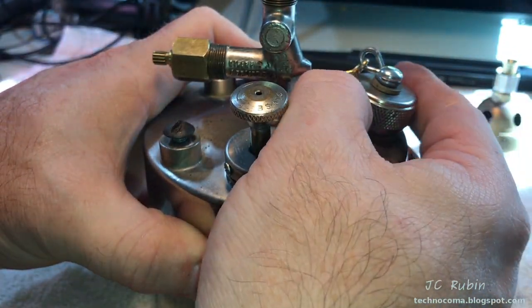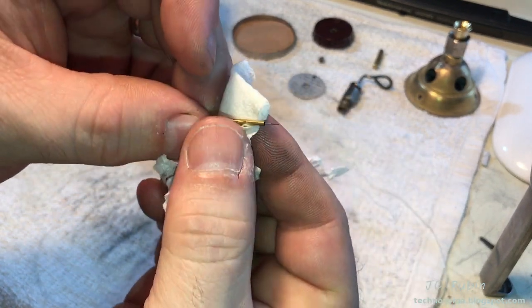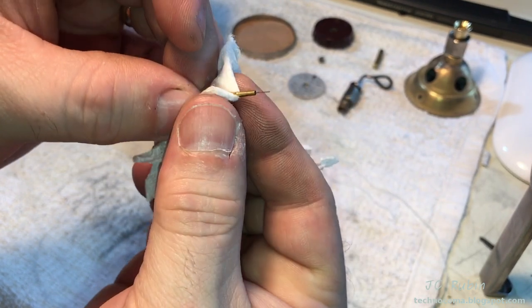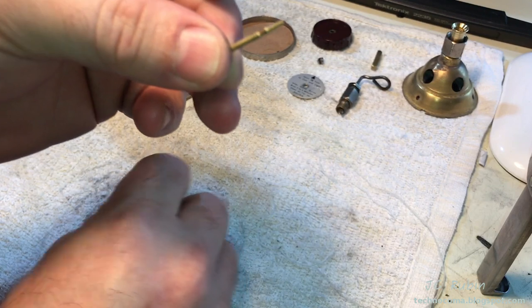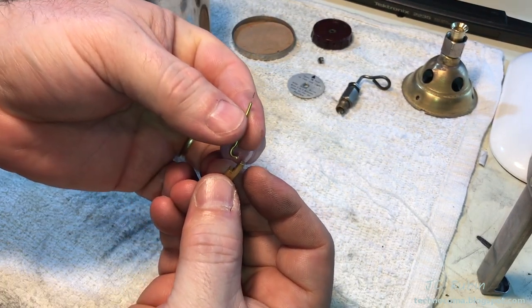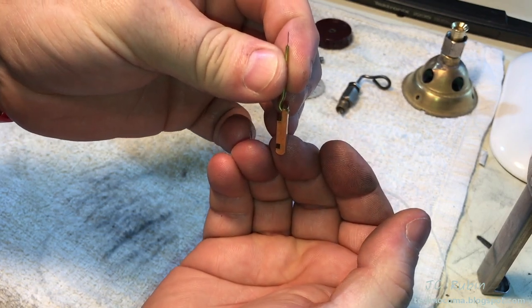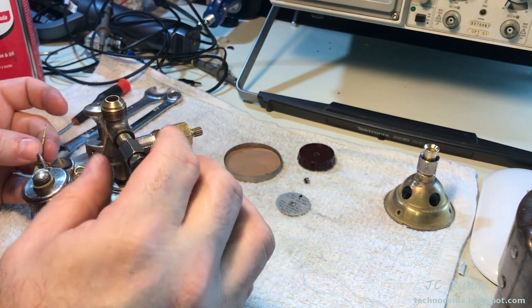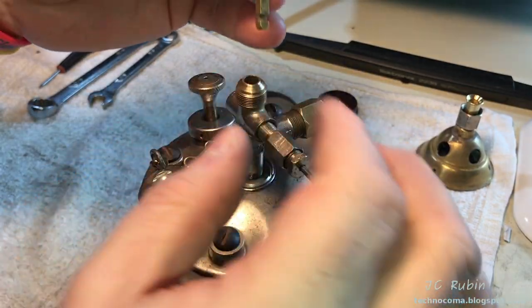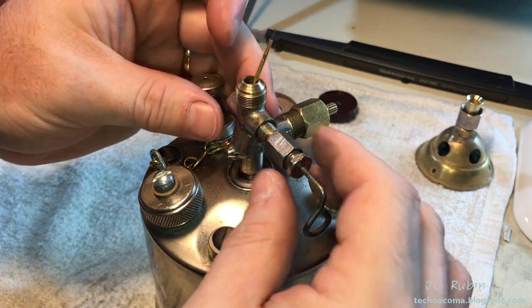Very good. I'll be cleaning off the cleaning needle just like this in this direction as to not damage it. And then inspect it. Make sure this is nice and clean. Seats onto the block just like this. I'll drop the cleaning knob back in just a turn or two to hold it into place. And the unit will be dropped in with the notch facing the cleaning knob.